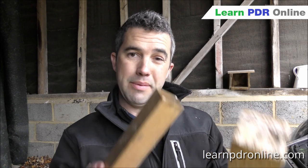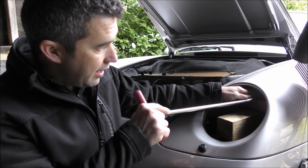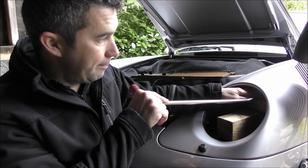Now whilst I do have a leverage block, I'm going to use a very technical product known as a block of wood — or maybe two blocks of wood. Sometimes you can have all the tools and all the necessary gear but often you just can't beat a block of wood. I'm going to use this for my leverage block. With the headlamp out of the way it's a big open space, and I can use extension bars to reach the dent, but I feel more control without the extension bar and with the bar closer to the panel. So I'm setting up this wooden block inside the headlamp aperture — it gives me just the right height to get to the repair in the right position.